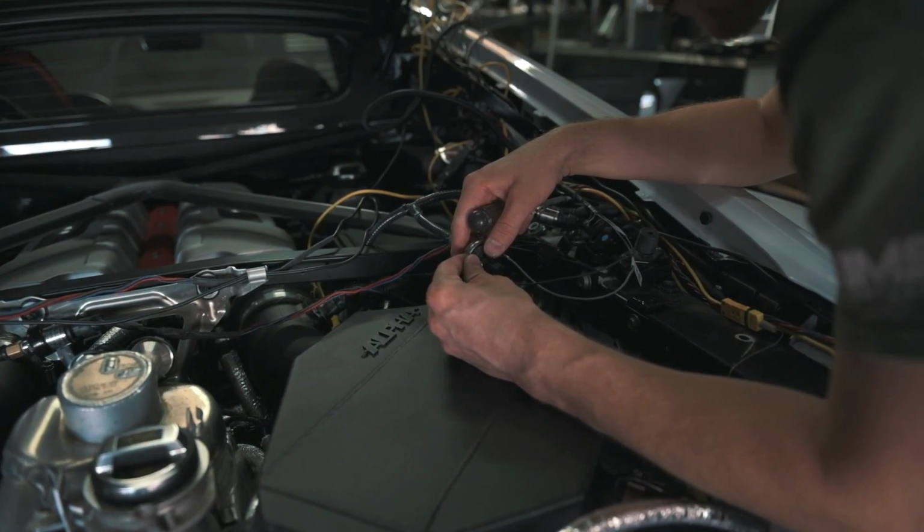And we're using a brushless pump. The reason that we did that is because, again, you have a lot of tubing, which creates a lot of pressure resistance just for moving the water through. To make a lot of power and to make it efficiently, we want that charge air cool. So the brushless pump allows us to move lots of water even at a lot of resistance without drawing a lot of power, and it's also very easy to control.